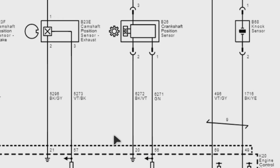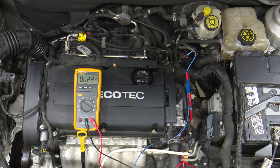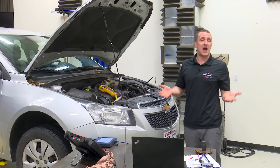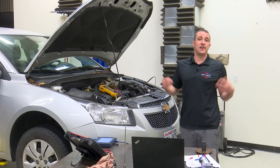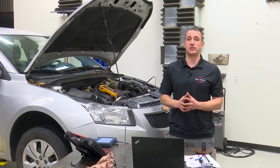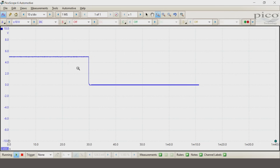Now we check the ground wire — that's on the black-and-violet wire. We're essentially doing a voltage drop test; since there's not a lot of current flowing, just make sure it's a very low number. You could also switch to ohm reading to verify good resistance to ground, though it may read slightly higher since there's probably a little current flowing through the PCM. Do not put a test light or any load between those circuits as you could damage the PCM. On the scope the ground is at a very low voltage — that looks okay.